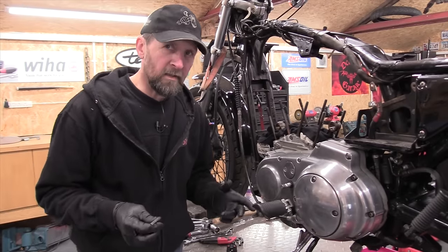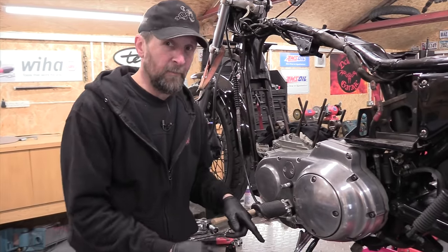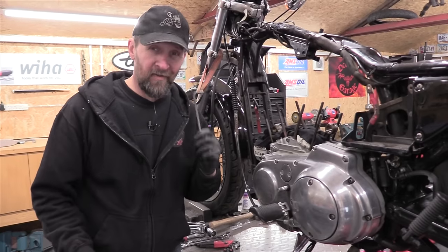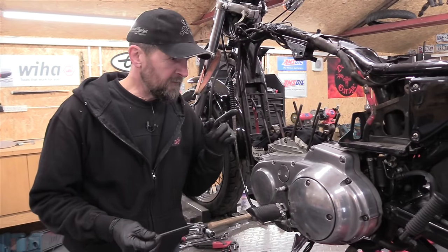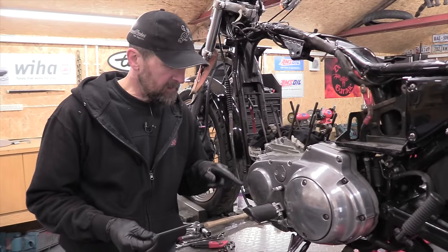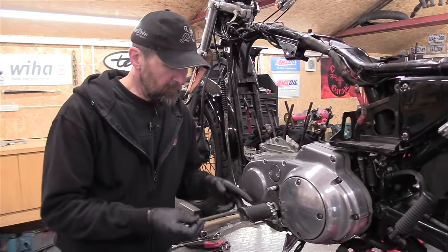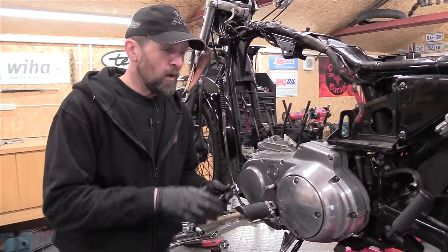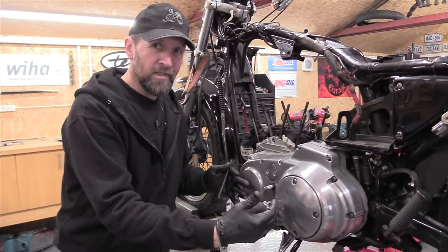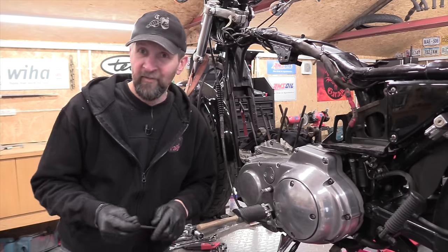To make this slightly universal as a video: if you've got a rubber mount model, then your foot peg will be bolted to the frame — I think they're 5/16ths, and they're very, very tight, so good luck with that. But if you've got the solid mount engine, the foot peg is bolted to the engine itself. These are all 3/16ths that hold the casing on, but the two that go through the casing, through the foot peg, partly holding the casing on at the same time — they're quarter inch, just a little bit bigger, because obviously they need to be a bit beefier.